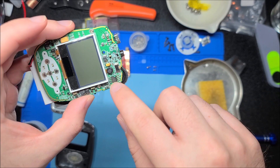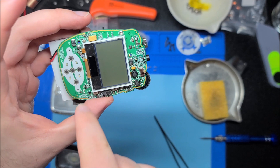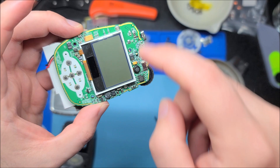There's a microphone — this device does record. There is a tiny little Atmel AT24C512N, which is a 512 kilobit serial EEPROM or flash — basically a serial memory chip that's probably storing local settings. We have the LCD which is monochromatic and backlit, a backlight connector, some power regulator components, and surface mount switches and LEDs.